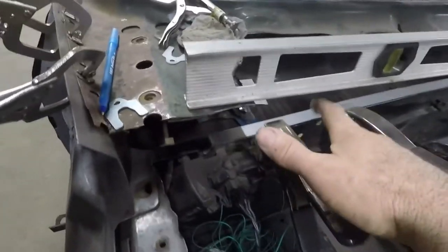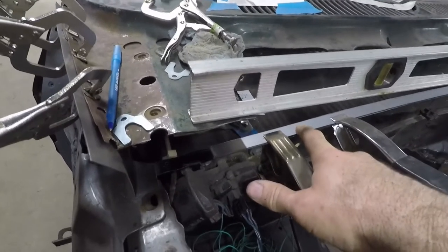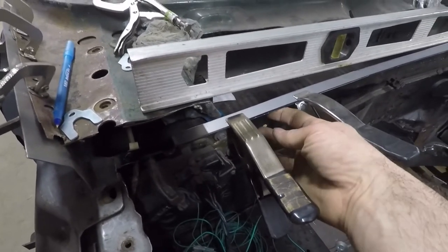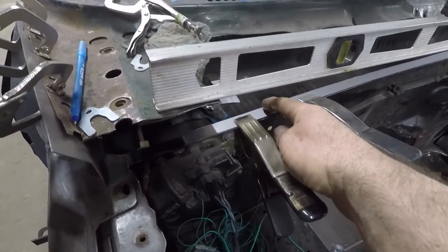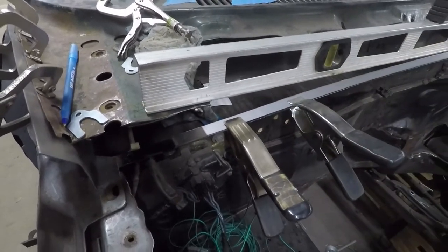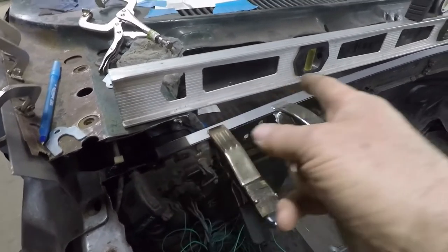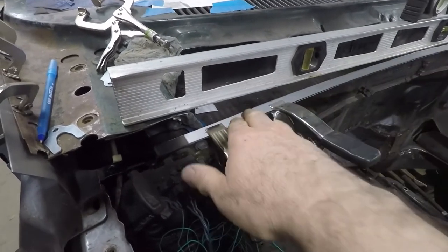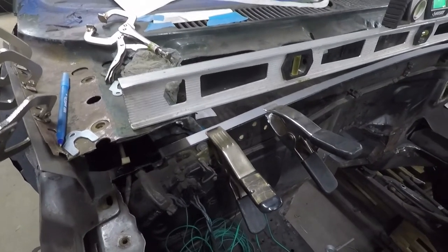I took a little piece of 20 gauge, only had it 48 inches long, and just put it on this top surface. The Miata firewall comes up and then wraps over. What I think we're going to do is make another one. We'll cut a piece about 43 inches, put a lip at the top, slide it in there and scribe the surface, and then tack weld that on for now — just see how things work.